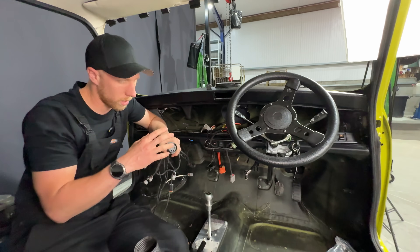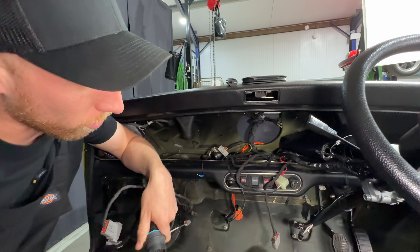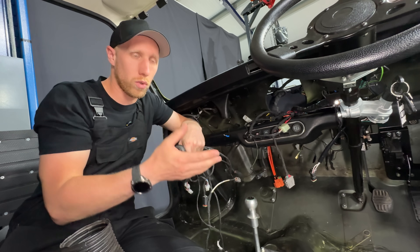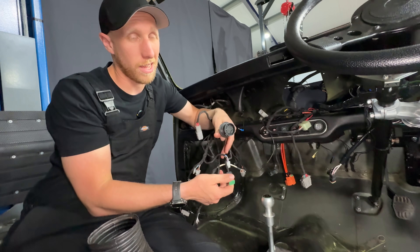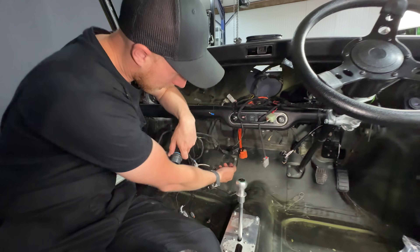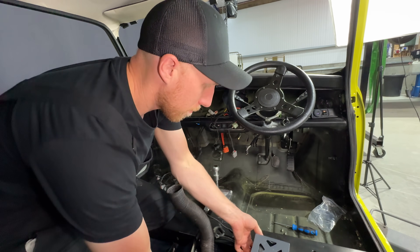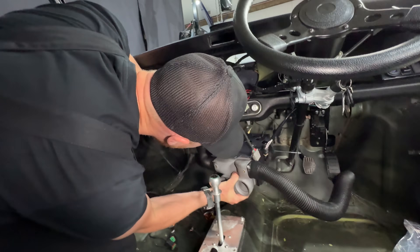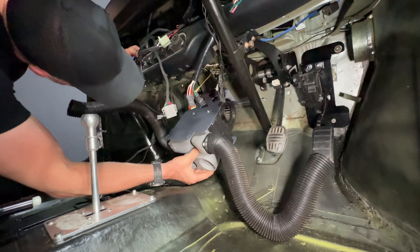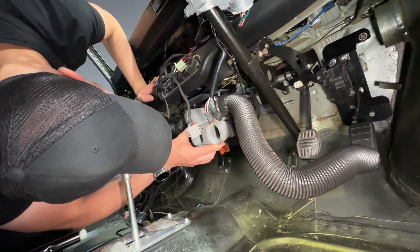Part of the mini kit from Felton comes with a cabin harness — you have a connector which bolts here, and on that you have your gauges, your heater box and all the connectors to plug straight in. There's more on this one because it's got the AEM dashboard which they don't normally have. Now fitting the heater box into place — it's got the HV cable here and should fit on all the original fittings. It just lifts up in place, hooks onto two little hooks up there, and then screws into two fittings just up here.